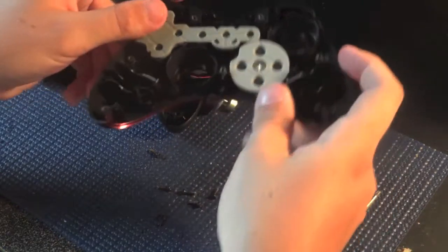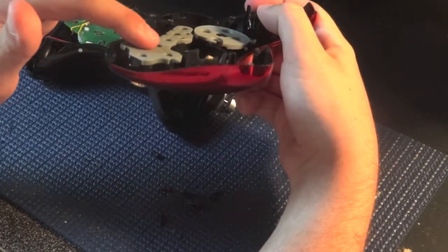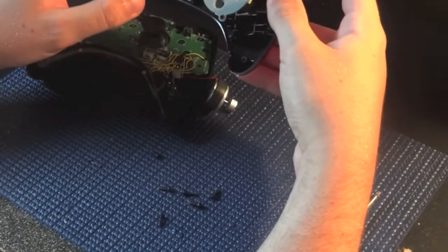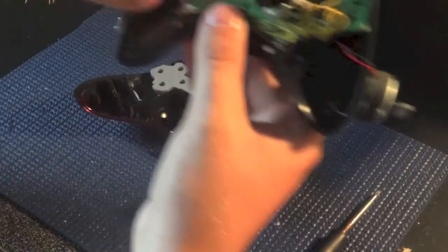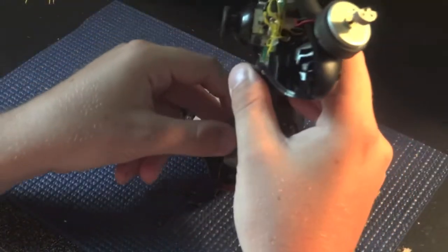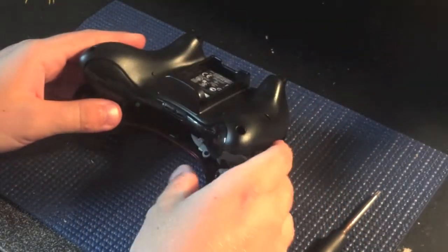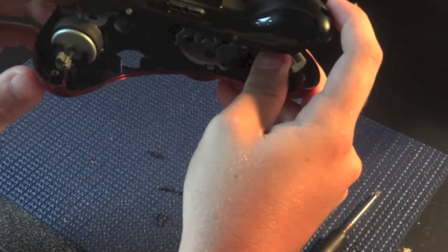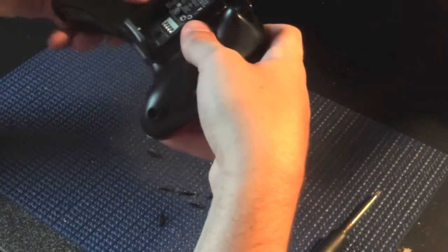You want to make sure those rubber pieces are flat — make sure everything is all the way on every button including the D-pad, otherwise they're going to malfunction and not work correctly. Lay the controller down when you want to put it back together, take each of the rumble motors and sit them in their spot, then put it down so the thumb sticks are in their spot. Make sure again that those rubber pieces are all aligned correctly and just seat the controller back together.